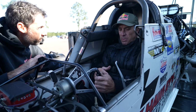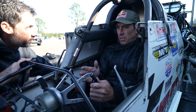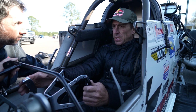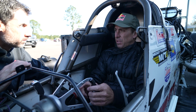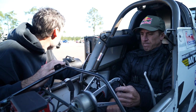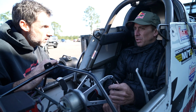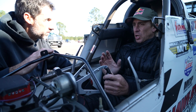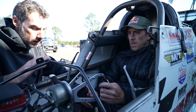That's right. Even after the burnout, obviously fuel stays on, I reverse back. Then I do the 300 footer or whatever, the first pass, and just brake. Then after I brake, I shut the fuel off, count 3 seconds, shut the engine off. Yep. And then just let the car get past the quarter-mile finish line and bring it off the racing surface itself. And so I'll gas to the 300, and then I'll kind of just brake, but just make sure you have enough momentum to get off the racing surface.